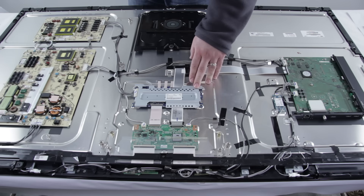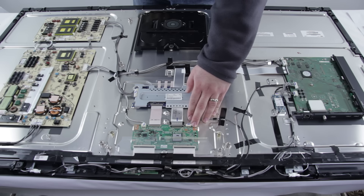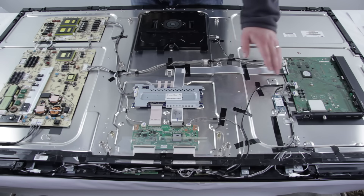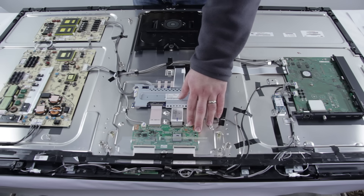If you find out that your TV does not have backlighting, this would be the most common problem: the LED driver. Some common problems with the T-Con board include having no picture on your screen, but your TV does have backlights and sound. Earlier we said it could be the mainboard, but the T-Con could also be at fault if that is the symptom.